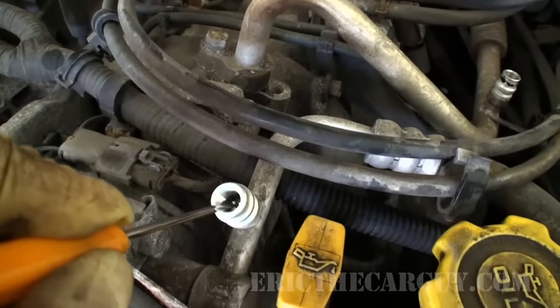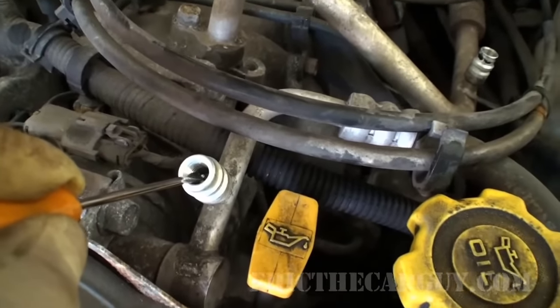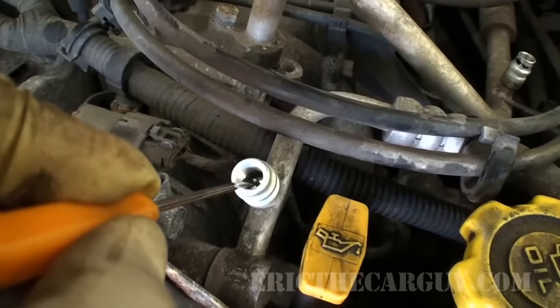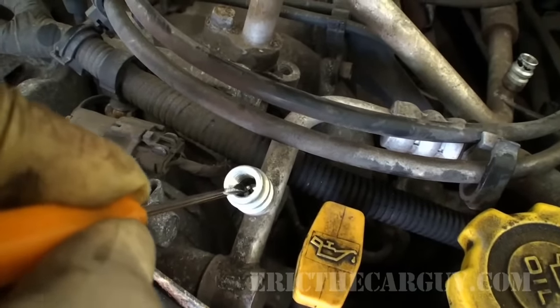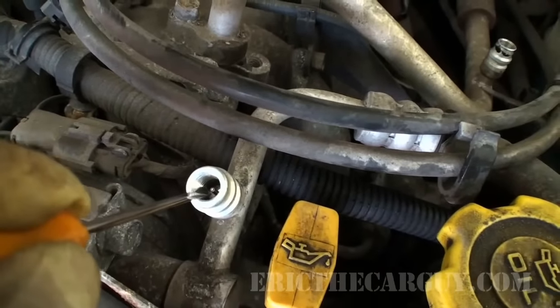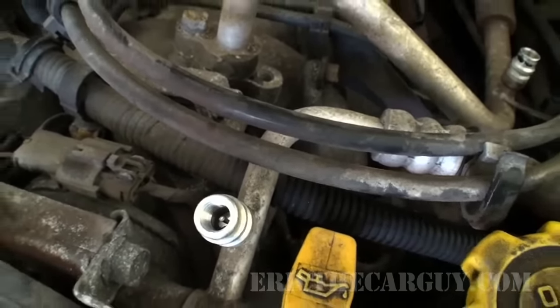One of the things I like to try is to just push down on the Schrader valve briefly to see if there's any pressure in the system. Since I don't have fingers shaped like chopsticks, I'm just going to use this screwdriver blade. Keep your face away and wear safety glasses — which I will do from here on out. It's the same thing as a tire valve. You can see I'm pushing down and there's absolutely nothing coming out, but if you get a little squirt, it means there's some pressure in the system, which is a very good sign.